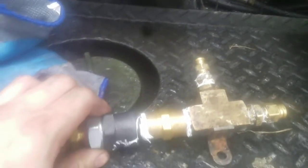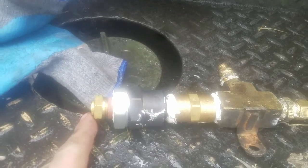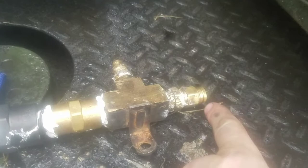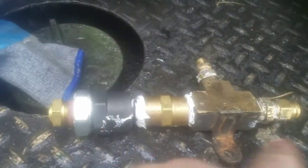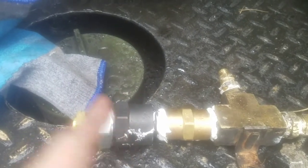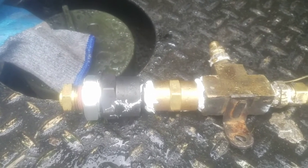Your finished valve will look like this. KN23000 valve — 3/8 inlet, down your frame rail, exit on the 3/8 on this end, and quarter inch will be your supply line. Basically you have to set it up so when air comes in from your trolley valve and goes to your trailer, it doesn't back feed into your system. This will actually keep you from going up to your ABS valve and engaging the brakes in the truck when you use a trolley valve.